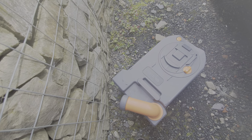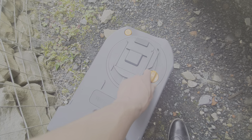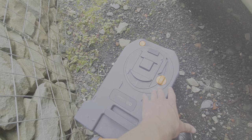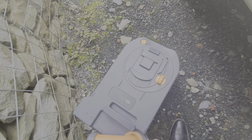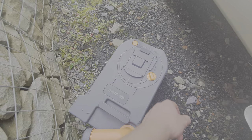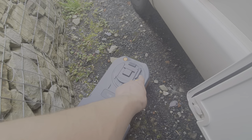You can obviously give it a rinse out. You will notice on this that you have got a little switch which turns and rotates. This should always remain in this position. You should never need to move this because this is what makes contact with the blade when opening and closing the cassette. If this is off angle, the cassette won't go in, and obviously if you try to remove it like that, it's going to snap. So always leave it in this position.